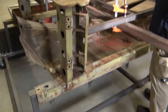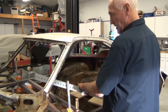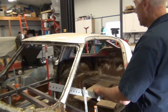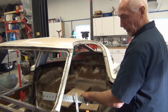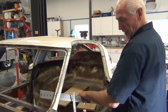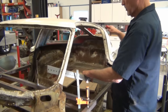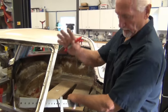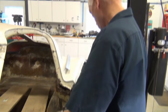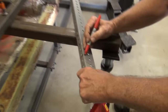What we're doing then — if I put pressure here, all I could think was possibly this roof and windshield may flex up. So our idea is to do cross bracing here to keep this from flexing up. Your fear is when you cut that bottom rocker out, this whole thing raises up — yeah, because I'm relying on the rigidity of the coupe birdcage up here to hold it. It probably would hold, but I don't want to take any chances, so I'm doing cross bracing here. This cross bracing will keep it from moving up, and this one will keep it from moving out.